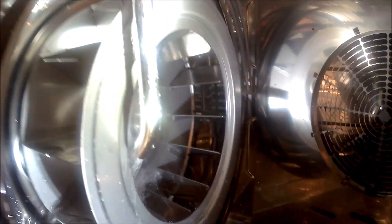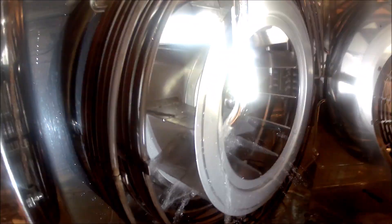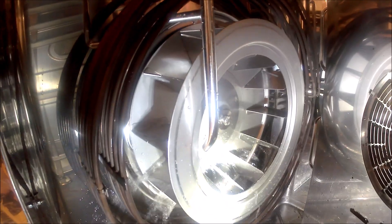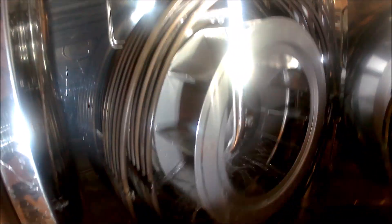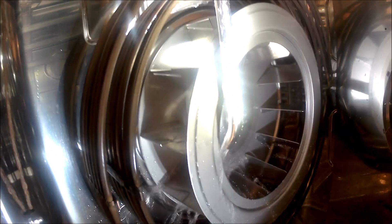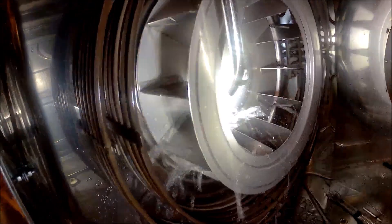Next we're going to test our pump which we've changed. We have full flow coming out of this pump — look at that water pressure, that is excellent pressure. It's not just going for two seconds and then slowing down. It's going the full duration of while we're holding the button, and that's what we need for full flow. If we have low flow we're only going to clean a certain section of the oven and not get to the far walls. That flow is super important, and as you can see it is really good.